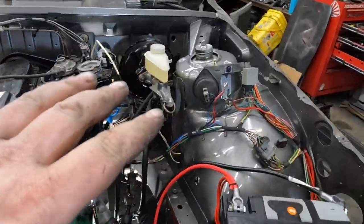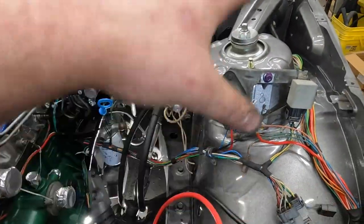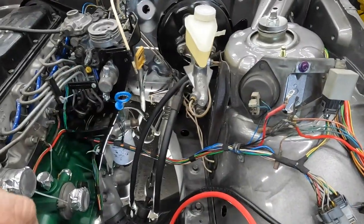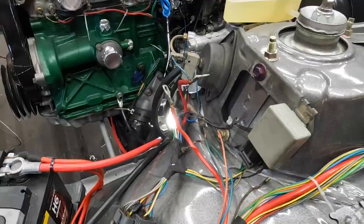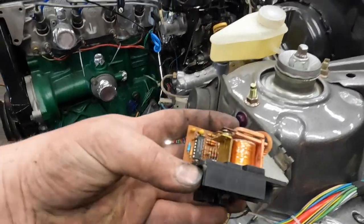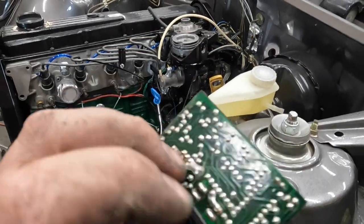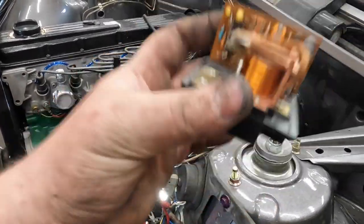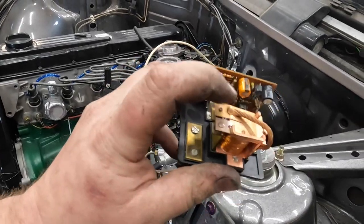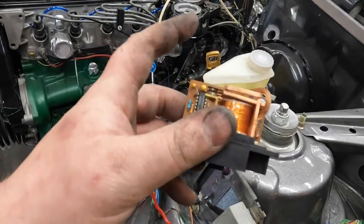With all this loosely laid in, before I go making it pretty, I'm going to actually try to get everything working first in case I have to do repairs or add or subtract wires. I'm going to start with the glow plug relay. I was going to use a little universal solenoid, but looking at this guy, that's just a big old relay — which seems to still work. It's just what talks to it that's fried. So I think I'm going to lobotomize this and just make it a switch so I can use all the original wiring and hardware and keep it looking factory.